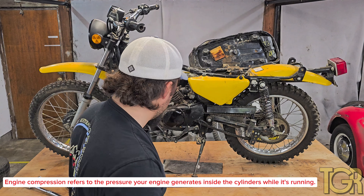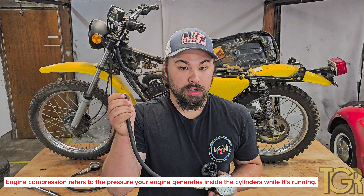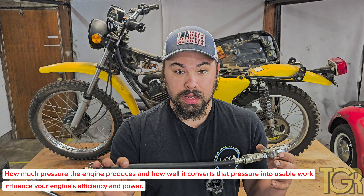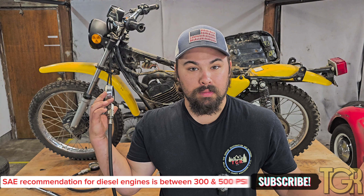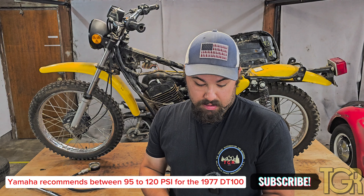Before I begin taking all this apart, I want to show you what I'm talking about when I say compression tester. A compression tester is this little gauge and hose right here. This end goes into where your spark plug goes in your engine, and this end here is what reads the pressure produced by that piston. These have all kinds of different attachments for different size spark plug holes. This can only be used on gas engines — the diesel ones have a very different end and a much higher pressure rating. Gas engines are anywhere from about 100 to 190 psi at the high end, and this motorcycle needs at least 90 psi to start.